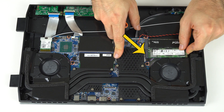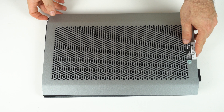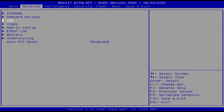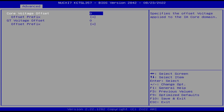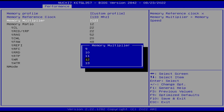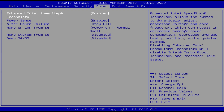Here is the Gen 4 slot. Putting the NUC X back together again was also annoying — the panel didn't go back on easily, and once I did finally get it on, it just didn't fit snugly anymore on the top. The BIOS is simple, and you'll even find stuff left over from the laptop side of things, like the battery. There's an undervolting option at the BIOS level. In memory options, you can set a custom profile to change the memory multiplier, but it didn't allow me to go above the 3200MHz speed of the RAM in Windows.